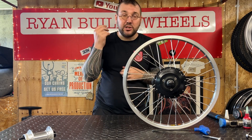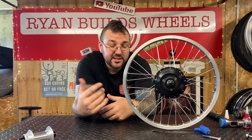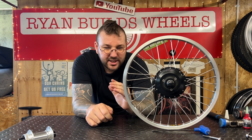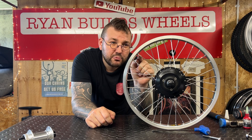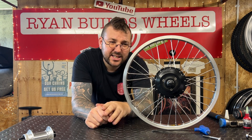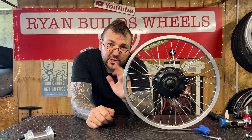However, you can't have too many crosses, because you've got two other things to consider — and that's why too many crosses can make certain wheels bad. What's going to happen is if you get too many crosses in a wheel like this, the angle of entry into the rim is going to get more and more extreme.